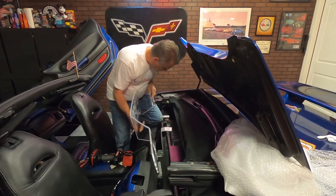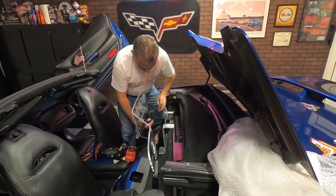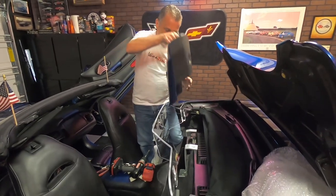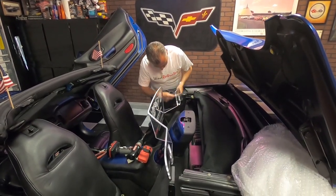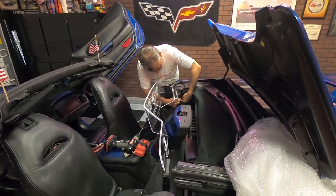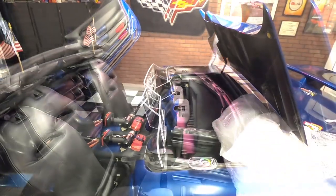It goes on like so. I can get the screws there to go in, and it will flex enough that you can get them in on this side also. We'll come right down the very front and tuck this in there. Now that we've got the deflector in place — it's still loose — we're going to go ahead and put the waterfall back in place. Then we're going to put the nuts on here onto the bracket. The instructions show you can use a crescent wrench, but I decided to use a socket. Those two are done, and now we just have these two over here. All right, we're finished — we can turn on our lights and see that it's working.